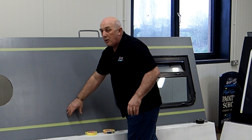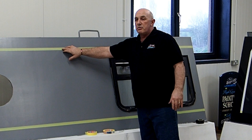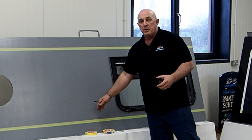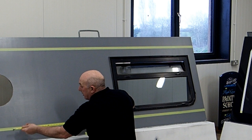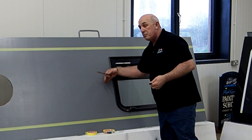Now, if you have a drain, we usually like to put a drop in there to separate the two panels so the water runs through the drain and away. If dirty water goes through your coach line and it's a nice cream colour, it might start to stain it over time — doing it this way avoids that problem. People have asked not just how to get coach lines on, but how to get the nice sharp corners. I'll pick a distance — we'll assume there's a drain — and work to that. This would normally be worked to a drain, a set of doors, or wherever your panel is going to stop.